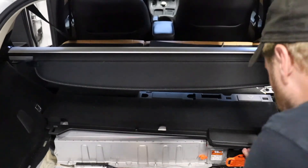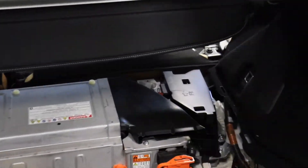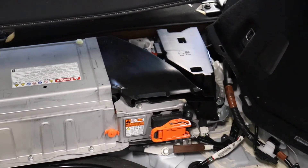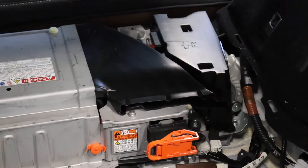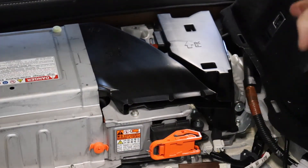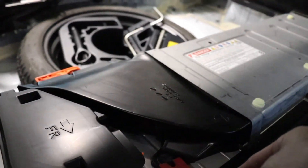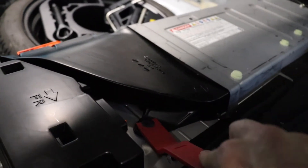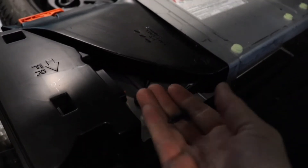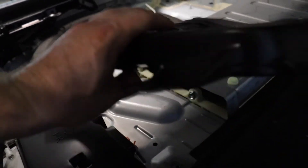We can now pull that piece out and pick this whole plastic section up and pull it up — Velcro piece, there we go. Take a look at that inconspicuous area right there, because that is where we're going — that's where our fan lives. We've got to get access in here. Next, we need to remove this vent piece right here; there's one plastic clip simply holding it there. Let's access that from the back seat. Let's use our trim removal tool and pop this clip right out of here. And that's all you need — this thing should pull out away from the unit like so. Ta-da.